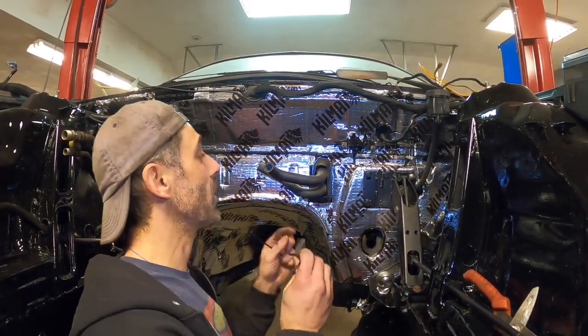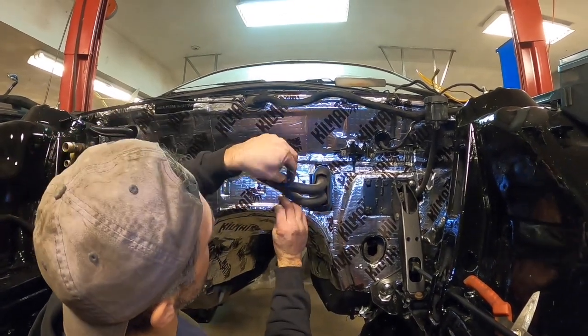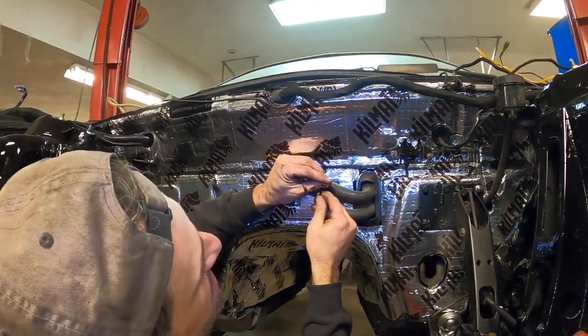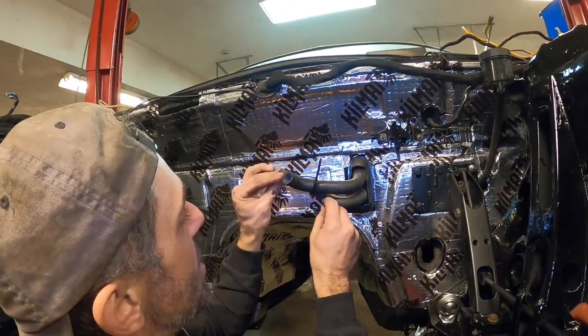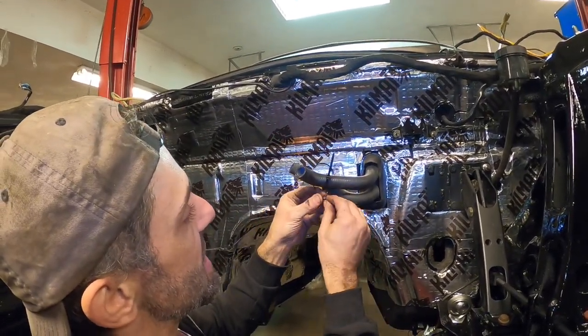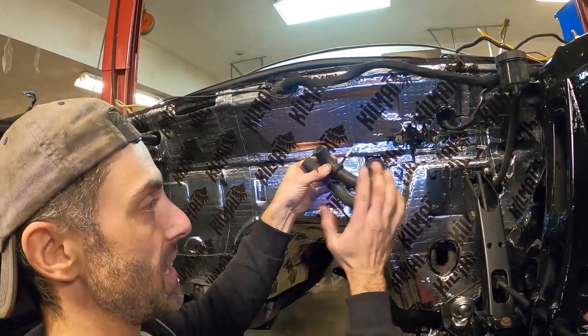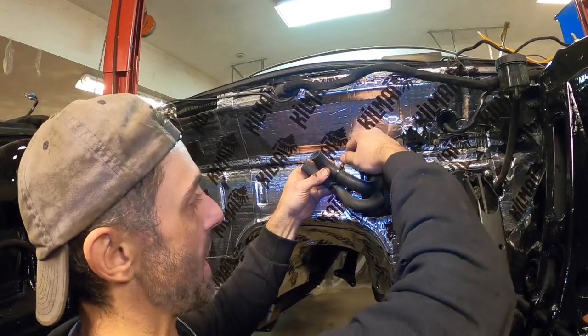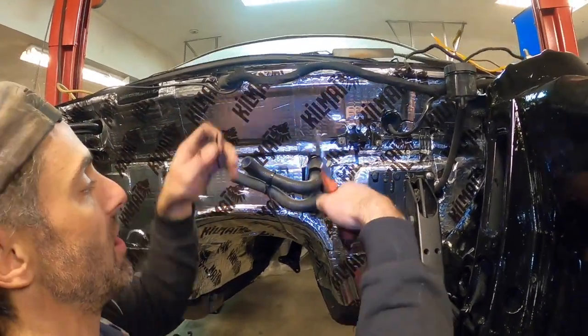So a real quick tip that's helped me out a lot when trying to wrangle up a lot of hoses and getting them to look organized is to easily do this with two zip ties. The first zip tie goes around both hoses, like you see here. Keep it loose. And the second zip tie goes around the first zip tie, just like this. If you want to get these hoses sitting in a specific location or specific manner, this is an excellent technique in order to really clean up your wires